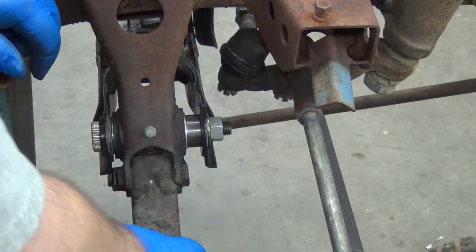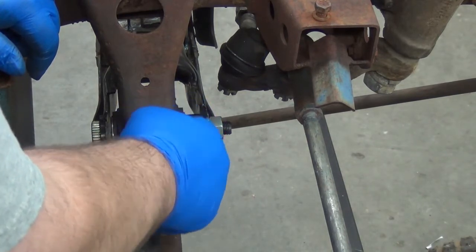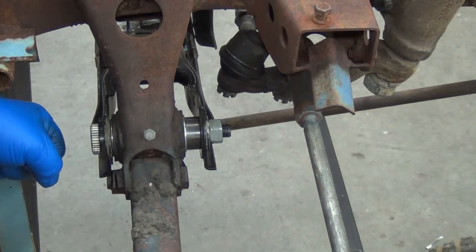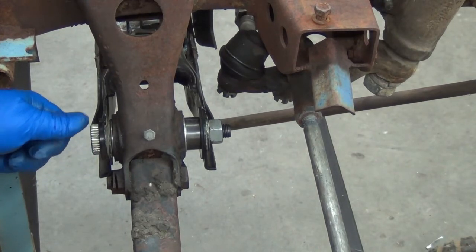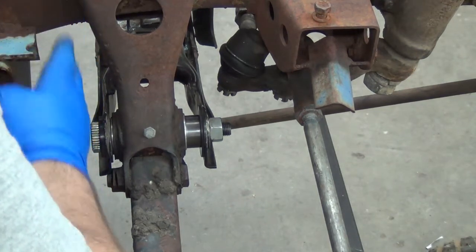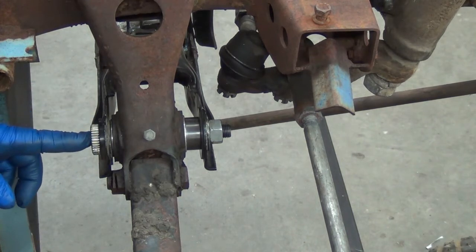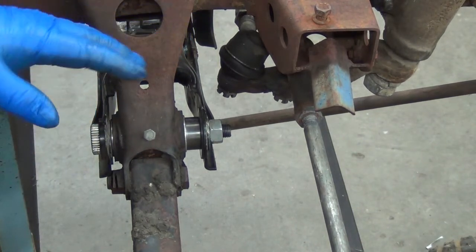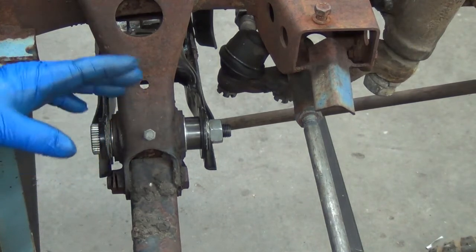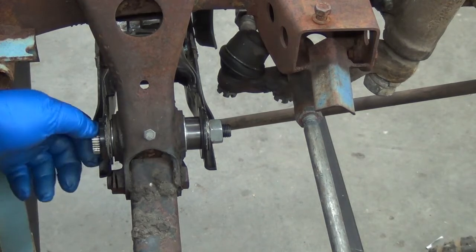we'll see. So anyway, now two 1/4 inchers could be replaced. The problem is when you take and only put a 1/4 inch in and put a 1/4 inch in over here, you're going to be pushing the torsion bar back a 1/4 inch. So you could probably get away with taking a cutoff saw wheel and slicing, you know, a 1/4 inch off the end of the torsion bar. Okay? You know, do that at your own risk. Make your own judgment call on that. There's other options I would do besides doing that first, but it is possibly an option.